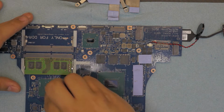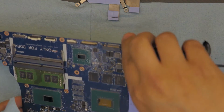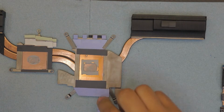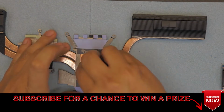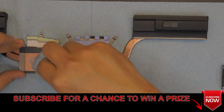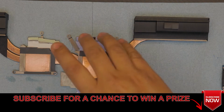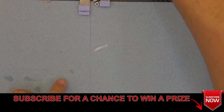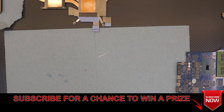There we go. Alright, once we clean the GPU and the CPU, we're going to put the motherboard to one side, and we're going to start cleaning up the heatsink. Try not to touch the thermal pads on these ones. Alright, now that everything is cleaned up, you want to make sure there's no thermal paste here on the towel. So clean up your working towel.